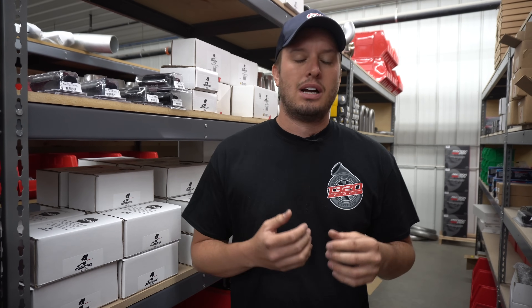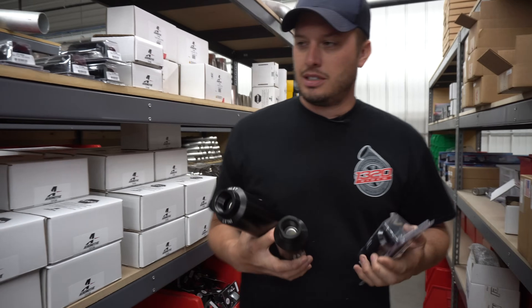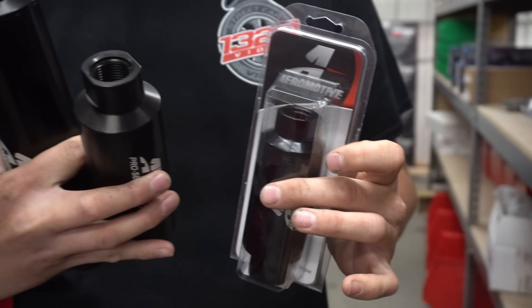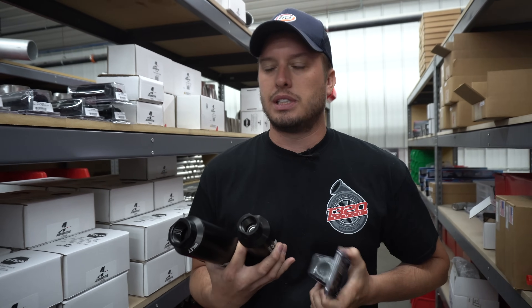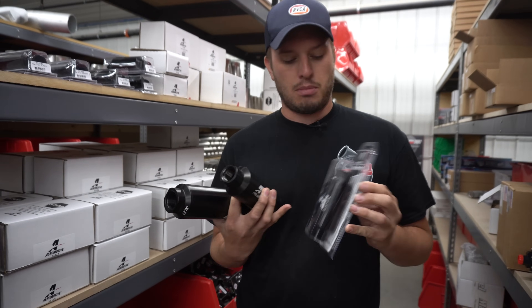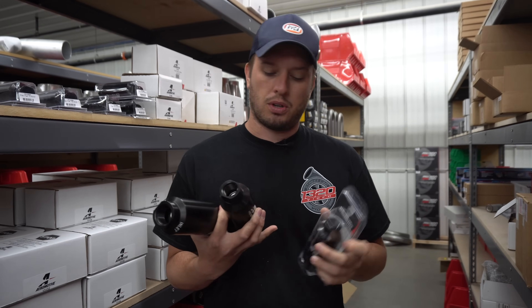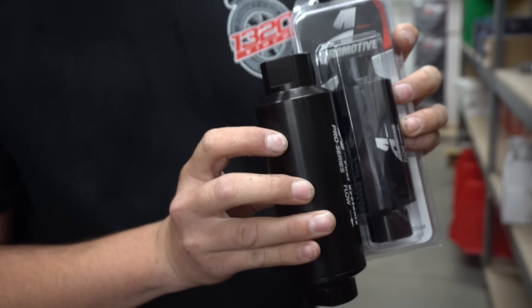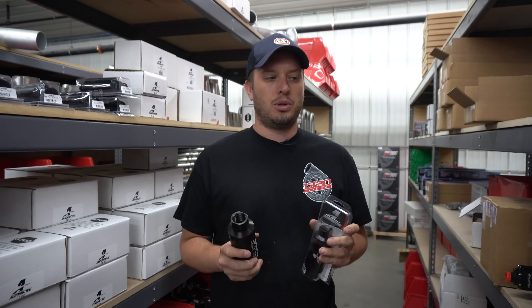All of those things — outlet on the fuel cell, line size, filters, regulator — go into play, which is exactly why we developed our fuel system planner. Now, I don't mean for this to be an Aeromotive plug because we sell Aeromotive, Waterman, Magnafuel, everything. But here you can see three filters. This is an Aeromotive number 10 filter — what you'd run on something like an Eliminator, about the same size as the Magnafuel filters we sell. Great filter for an Aeromotive Eliminator 1000 or similar. It has a number 10 ORB and flows perfectly for that application — like the Magnafuel 4303.